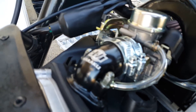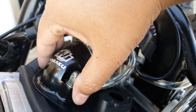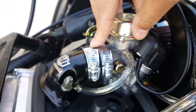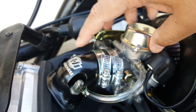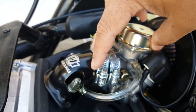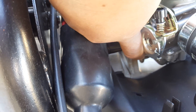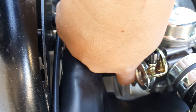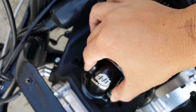What I did was take out the whole intake manifold studs including the bolts and everything. I squeezed this all the way fully until it was blocked from here onto the intake manifold, compressed it as much as possible, and then fit it in first. There's a little thing that hits the bushing of the crankcase at the bottom — this would not go inside if I did not remove the studs. So I removed the studs first, footed it in, and made sure it goes underneath or beside the bushing.